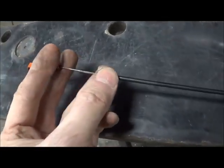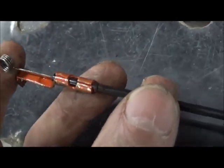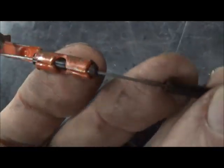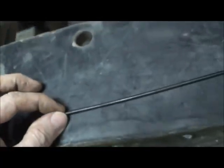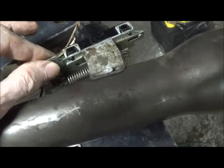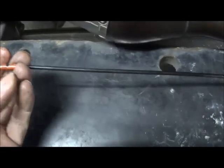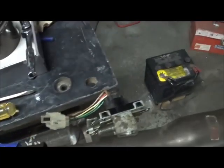Here's the problem that I have with mine — you see the sheath is broken at the top, right there. If those two pieces were together, then the sheath, which grips here, would then be pulling the switch up. But because it isn't, I'm not getting the proper translation of the switch to compensate for the head movement.